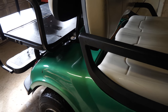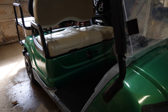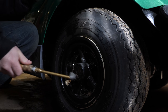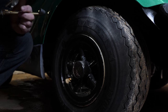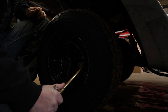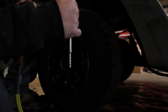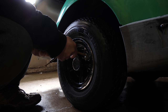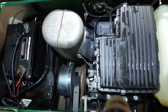We're not doing any repairs, just a full service. I wanted to bring you along for this one. This cart has been washed — we just pulled it out of storage, it was in winter storage. Checking the pressure: we're at 10 psi. I like my tires to be at 20, especially when they have a back seat on them. A hair just below 20 is typically where I'll land it.